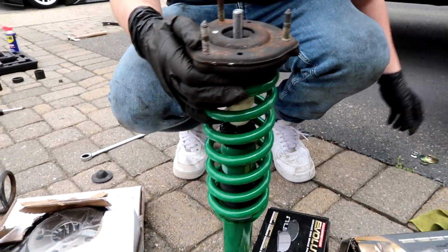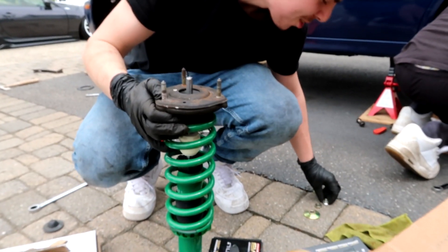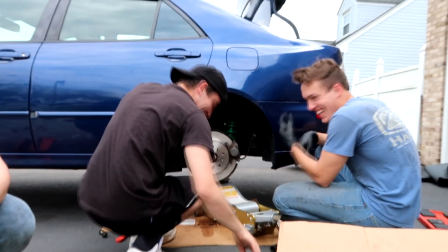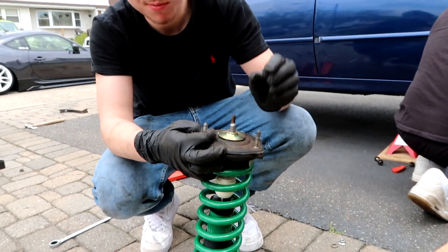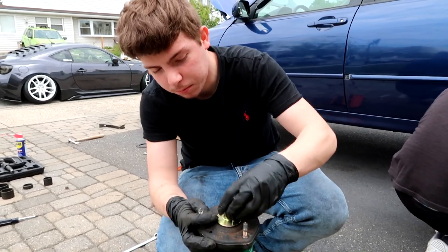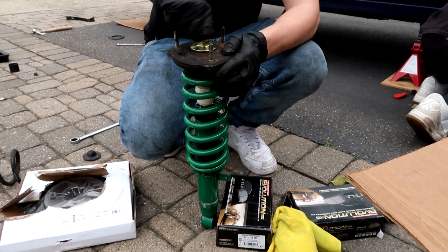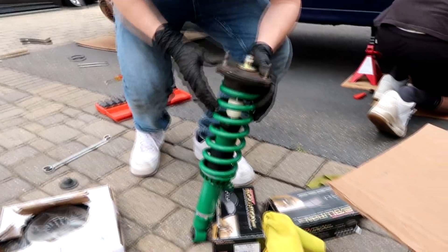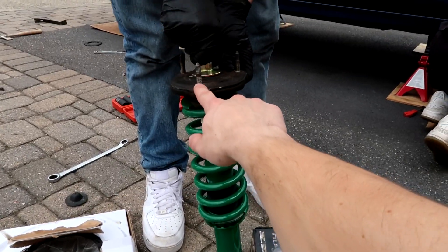Now the hardware — Tein gave us hardware you could reuse. So we got the big washer first, followed by the smaller washer, and the nut. This should be a 17mm nut — now we're just gonna tighten that back down and throw this back in the car. As we tighten it, I'm going to compress the spring a little bit. We should have no problem fitting it back in because the aftermarket coilover is a lot shorter than the stock one. So we're gonna throw these back in under the hood and hopefully just mount this all back up.